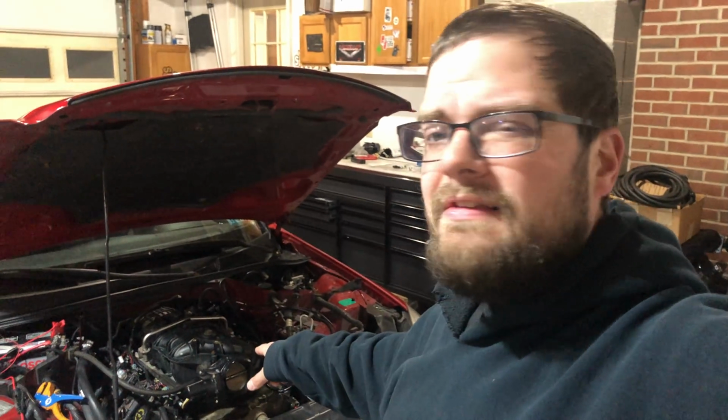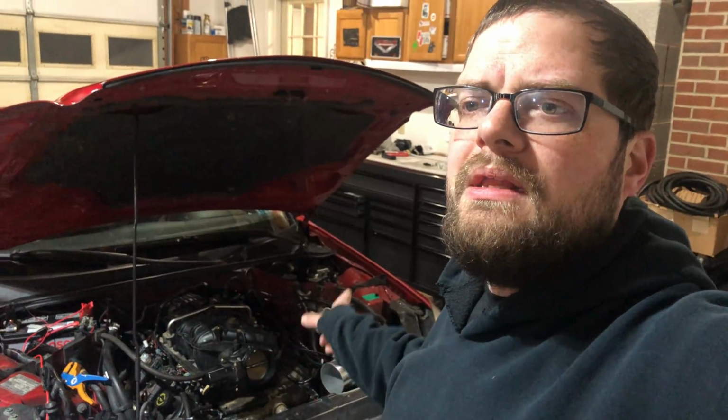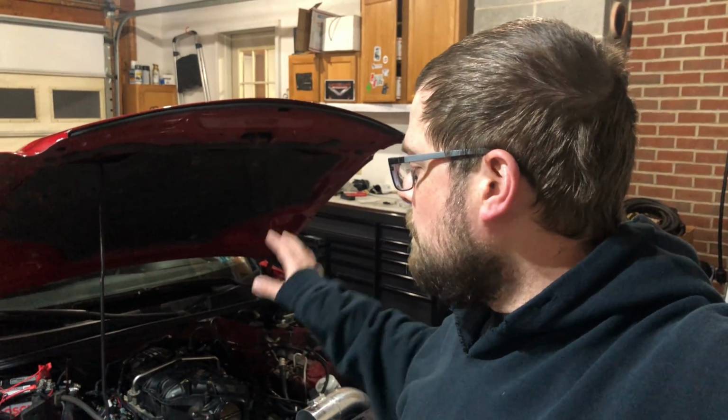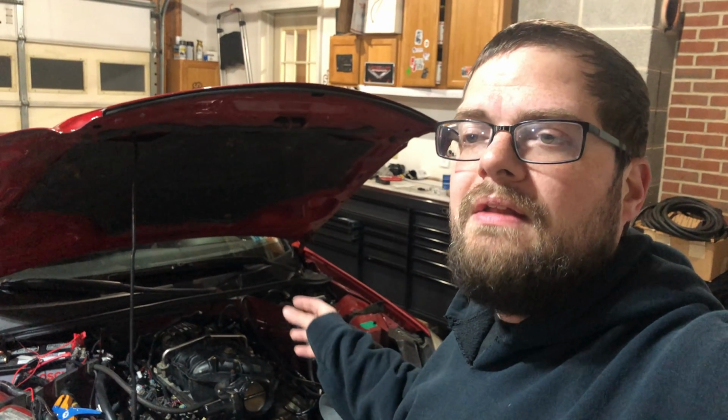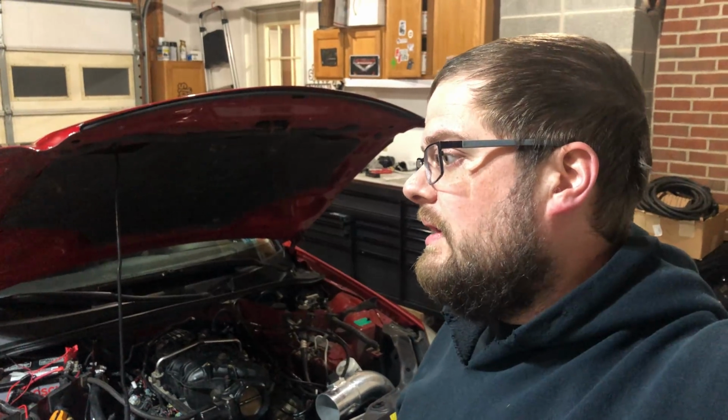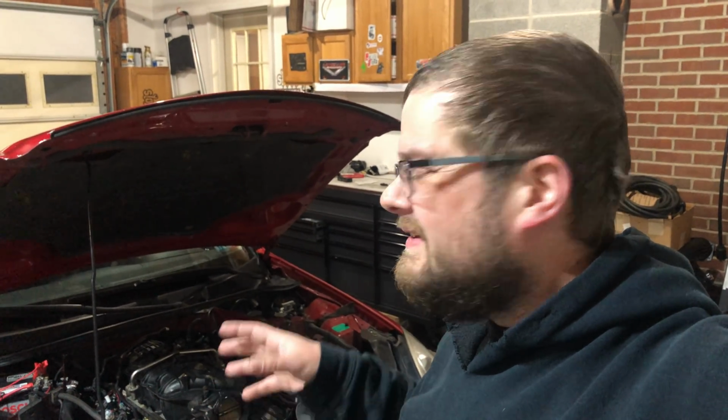Honestly what happened was this had 799s. I put the blower on, and then I put 862s on to raise the compression, and it made better power up top, but less down low. Anyway, circle back, truck intake dyno pulls with the different heads, and then swap the intake, see what it makes. So that'll be a neat test, and then I'll decide what I want to do.